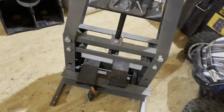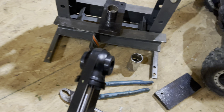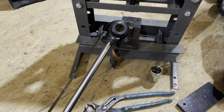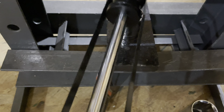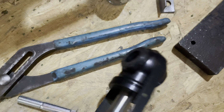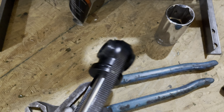I'm going to figure out how to set this up and press it in. I was able to press this in - it's a lot easier than the other end. Basically what I did is I'm using an inch-and-one-sixteenth socket - if you had inch-and-an-eighth it'd be better. I'm sitting it on top of a block and using another block to basically press it in. That slides in pretty quickly and then I can go ahead and try to get the first one installed.